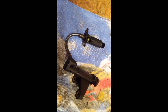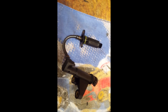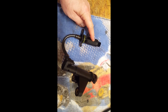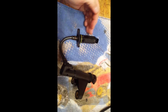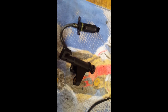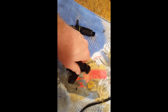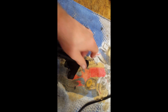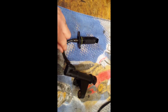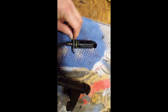After I replaced the oil pan the last time, I noticed the oil leak was still there. I looked around some more and finally looked at this part of the oil sensor, which sticks out of the top of the oil sump. The rest of this stuff is up inside the engine — it bolts inside up in the oil sump — and if you take this cap off, there's a pressure sensor in there. The signals from this go through this tube here, which contains wires, but apparently oil gets in there somehow.